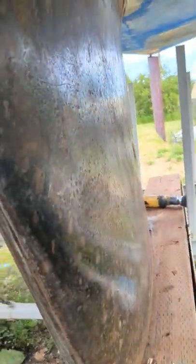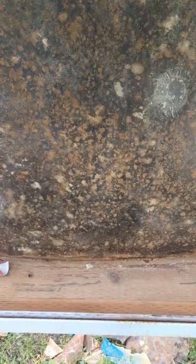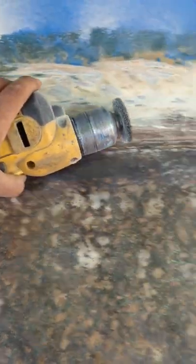And you can see I've got it all sanded down pretty good. Before I take these boards down and let the keel rest by itself, I'm going to work under the boat as much as I can to get all the sanding done, and basically getting the crease right here. As you can see, this is the time consuming part, so I'm just chipping away all the old epoxy paste, and using a wire brush, going like this right along it after I chip it away.